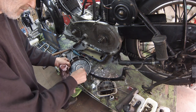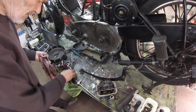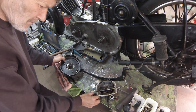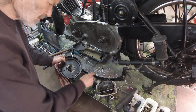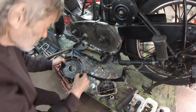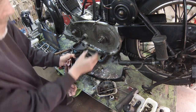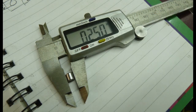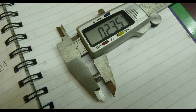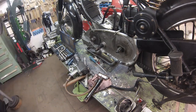A standard quarter inch by quarter roller will go in, but leaves no side clearance, which equates to a light interference fit. The clutch basket will be reluctant to turn. When it gets hot, it will seize. Especially ground rollers were hard to come by in the dim and distant past, and the trick was to add a shim of about 1.5 thou, which provided clearance without interfering with function. The POC spares scheme is among several suppliers of the 0.25 or quarter inch by 0.23622 inch or 6mm wide rollers these days. You 21st century Panther owners just don't know how good you have it.